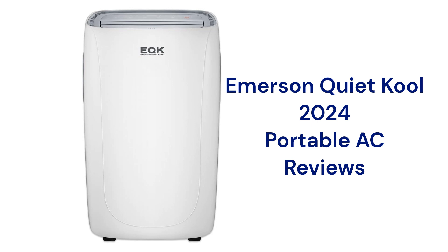This brand is made in China and is available online through their Amazon store, and they are backed by a pretty good guarantee. They only use a single hose, which means that conditioned air from the room is constantly being exhausted to the outside and has to be replaced and conditioned, which results in lower overall efficiency.